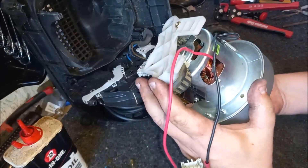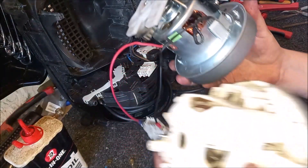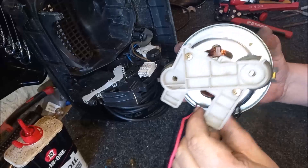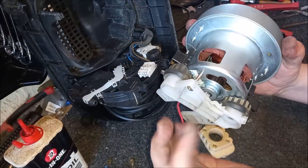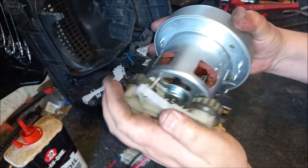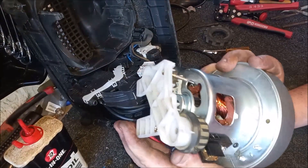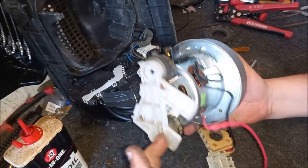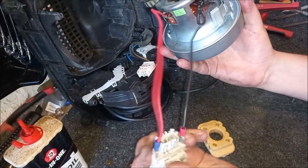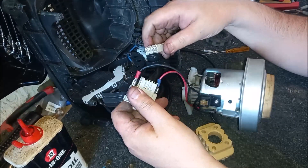And we've got this one. As you can see, a bit of a bodge job here because it's a bit shorter than the original Miele motor - not by much, but just enough to cause a problem. So I had to mount the rear bracket and actually put some wood screws through. This should be fine because it will still be compressed within the body. This is just to stop it moving, because when the motor starts there actually is a soft start on this machine, so it's not so much of a big problem. Those screws connected to the rear mount will hold the motor in place. And then we've just got a couple of wires here, running to the speed control module, which connects up to the loom.